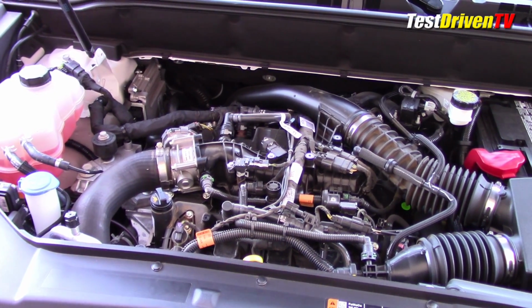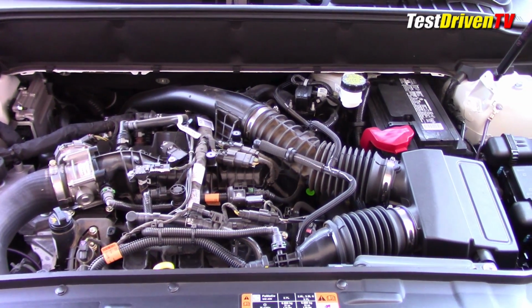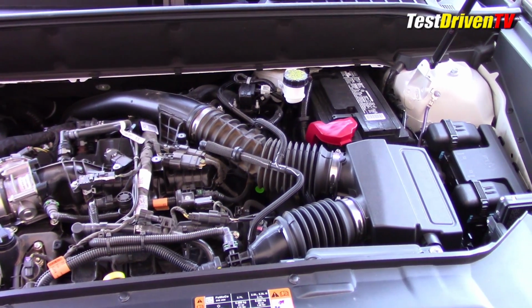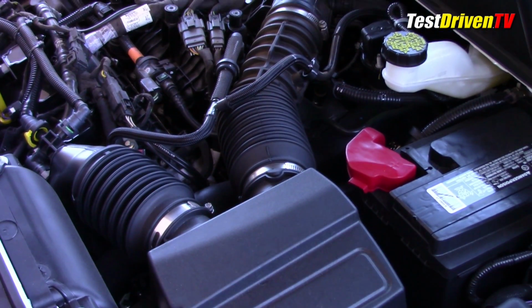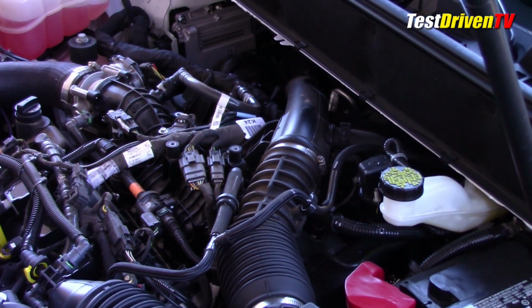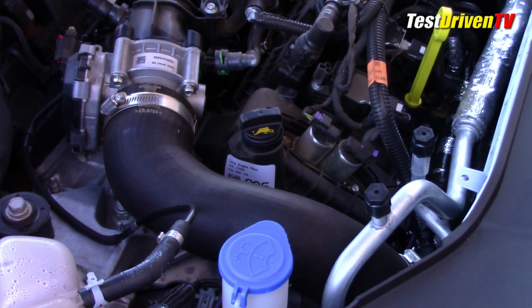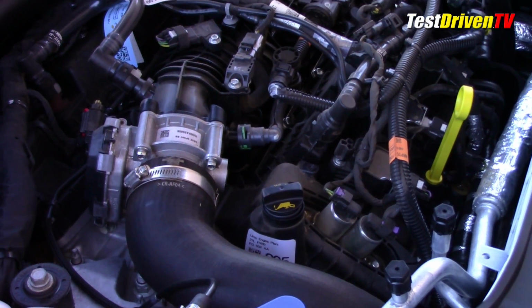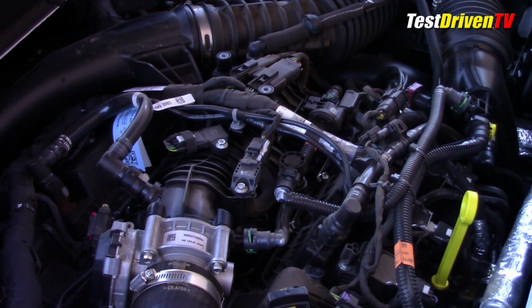Under this hood, it fits pretty snug and has a clean installation with very little turbocharger plumbing visible. The air comes into the filter box just above the grille and then splits in 2 different tubes to each turbocharger hidden down below. From there, the air heads to an air-to-air intercooler in front of the radiator, hidden from view as well. After that, the intake charge makes its way back up into the engine through a throttle body and into a plastic intake manifold that really isn't all that pretty to look at.